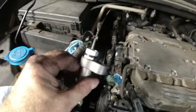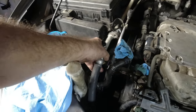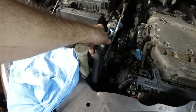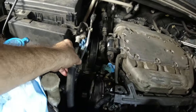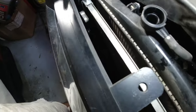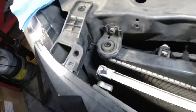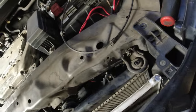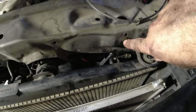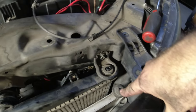System's open. I got this hose off — it goes to the compressor. I'll put the nut back on so it doesn't move around. I got the condenser; there are two lines on it and now it's loose. I disconnected the grille from here — those are 10 millimeter bolts. Pretty much everything is 10 millimeter. There are brackets that go here — I took those off. It's a 10 millimeter and there are little rubber isolators on there.